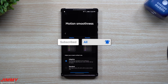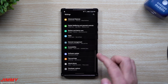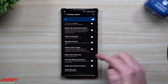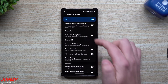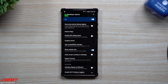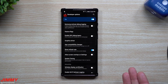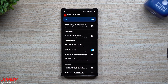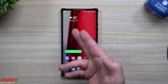Hit the bell for notifications to get notified for all future videos. Before we turn this on, let's go inside the developer options because I want to turn on the option that shows the refresh rate on screen. Scroll down and look for 'Show Refresh Rate.' It puts a little green number at the very top that switches between 120 and 60 — that's the adaptive part. When there's no scrolling or movement, it keeps it at 60; when you scroll, it jumps back up to 120.